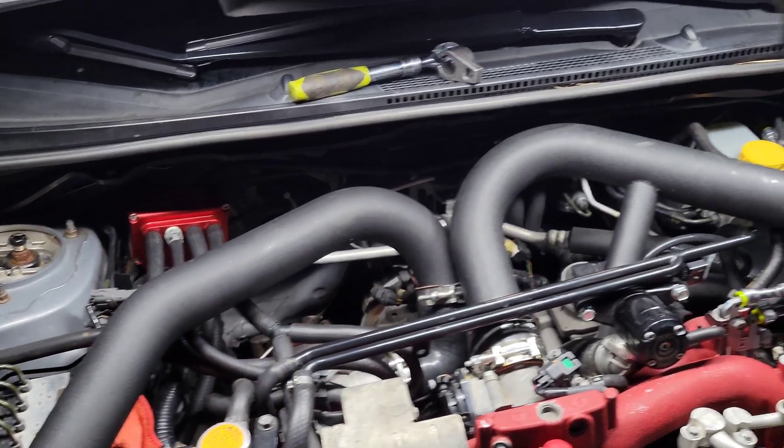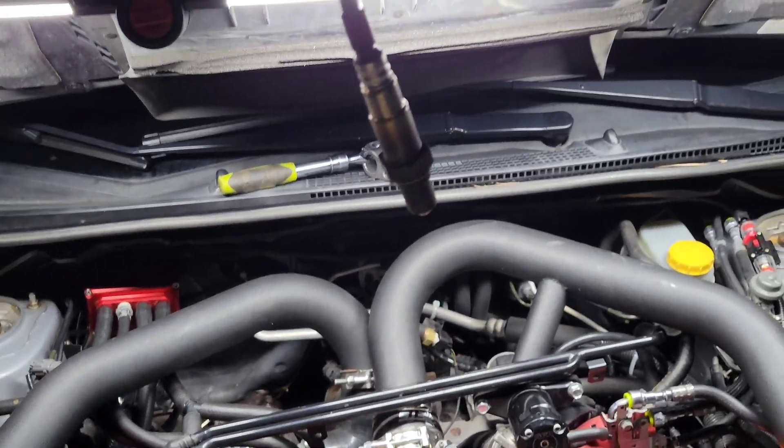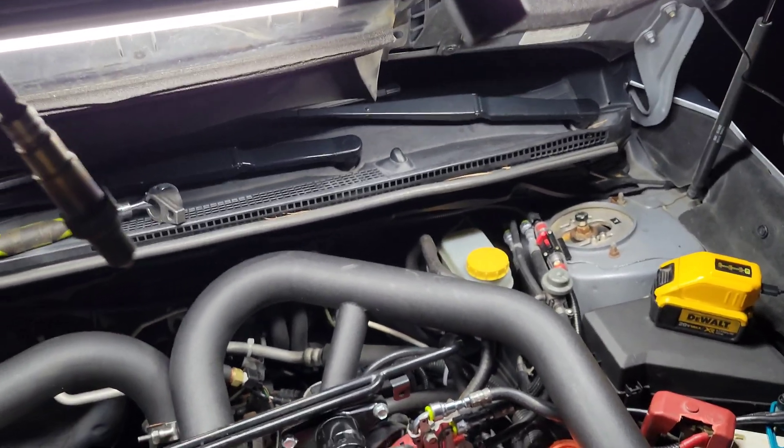Let's go check on the gauge. Alright, now I'm back in the car. I have that turned on — it's going to read O2 error. O2 E2 — that's the error we're looking for. Let that run for 30 seconds. Alright, now after 30 seconds we're going to power down. Now I'm going to take the O2 sensor and plug it back into the connector, and then I'm going to power it on, leave it outside of the vehicle — outside of the exhaust system — for 60 seconds as it's calibrating. Once that's done, put it back into the exhaust system and everything's calibrated. It's going to stay calibrated as long as I keep this sensor plugged in. Once I disconnect it, I'm going to have to go through the recalibrating all over again.